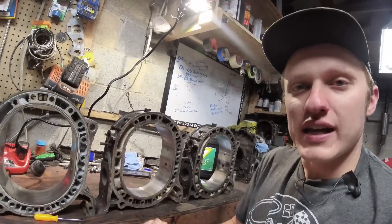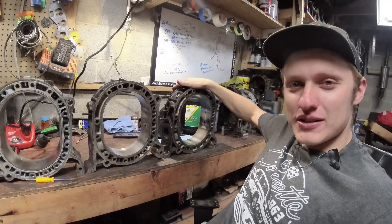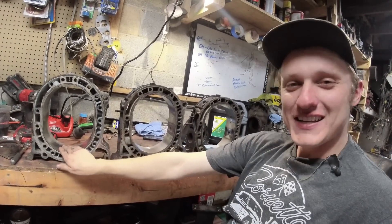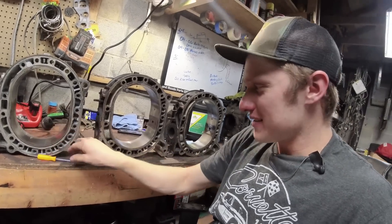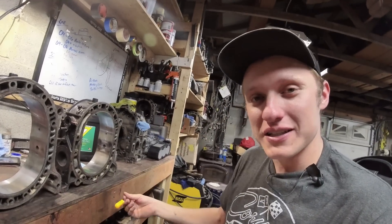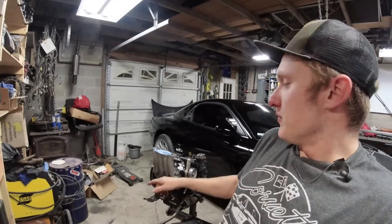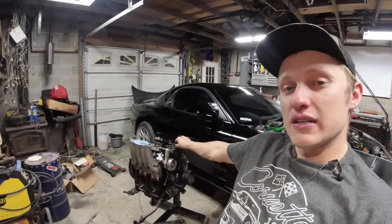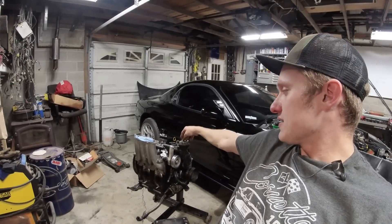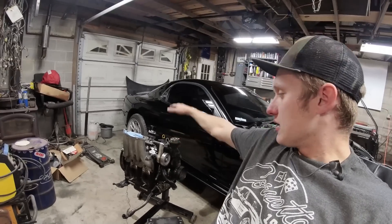So what would you say now that you've seen these — the guy that ran the REW engines with pre-mix, his housings are roached, and the guy that ran the RX-8 engine without pre-mix, his housing looks mint. So it would be a little counterintuitive to what we're talking about, which is pre-mixing and apex seal wear. Getting to this engine — the case study on the Black FD is iRotary apex seals, resurfaced housings, and we ran this engine on one ounce per gallon of Renewable Lubricants Bio-Rotary Racing pre-mix.